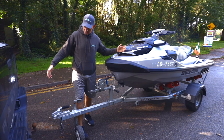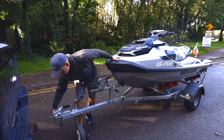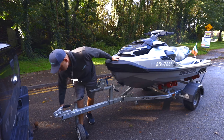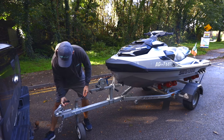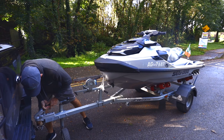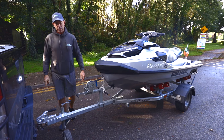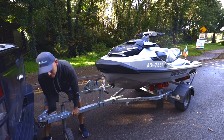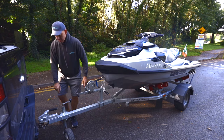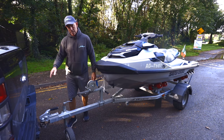A typical example here — you have your trailer and you want to put it onto your jeep. A lot of the extreme trailers come with these safety chains, so first of all lift up your ball, put on your safety chain, and put your hitch down. The more times you can check this the better — grab it up and down, make sure it's okay. That's the main thing holding your trailer onto your jeep, so that has to be right.